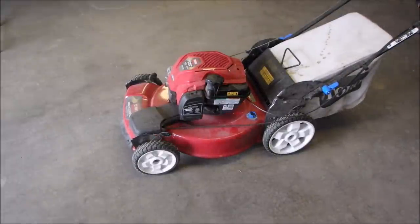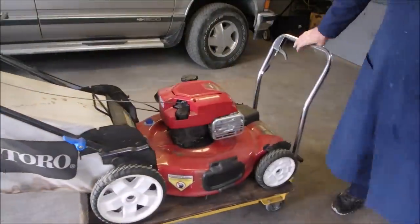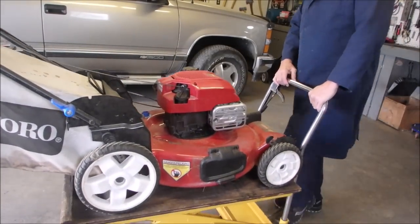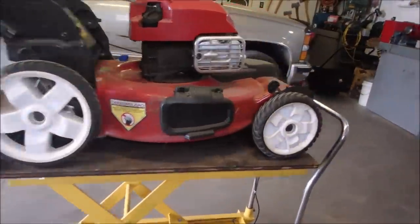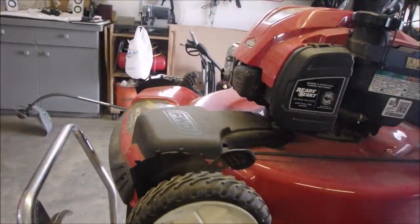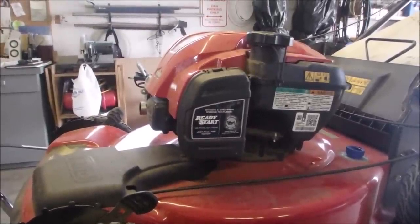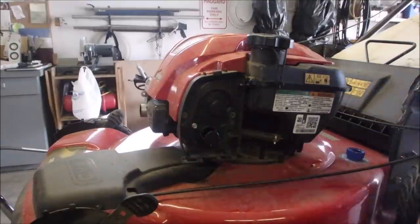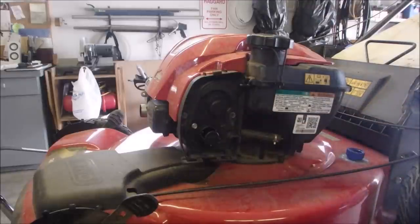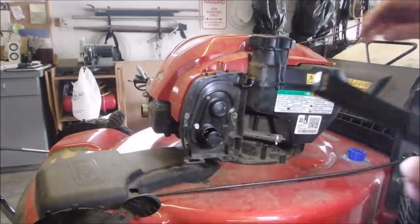Let's get it on the bench. I'll wrap up on the hoist and we'll go to plan B. We're going to go to the other side. Oh, it's got the plastic carburetor on there. Let's just have a look under the air filter. That looks good. Oh, the choke is open. I get to use my new lights. And the choke is open.